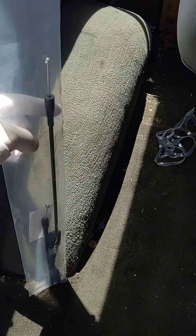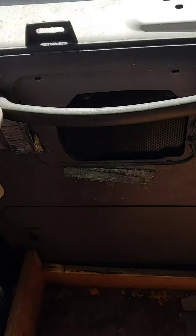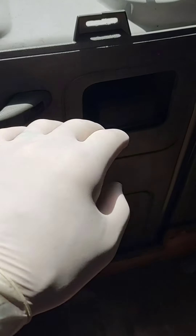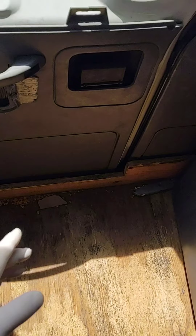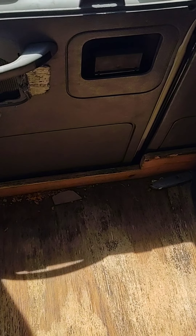In order to do that, I'm going to have to climb over the back seat and I've got to take the door panel off, which is a little difficult in here because there's a board here to hold stuff in the back - he uses this for a business that he does. What I've got to do is take this handle off and take these screws out, and then there's a plate I've got to take out. There's not a direct hole where you can see the components for this, so you have to feel up in there and kind of do what you can to get to it.